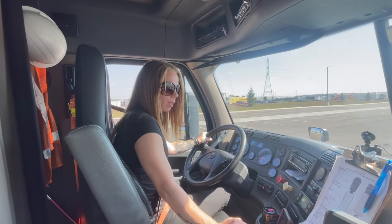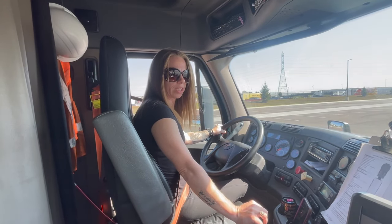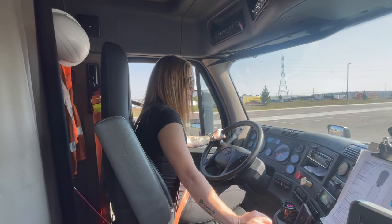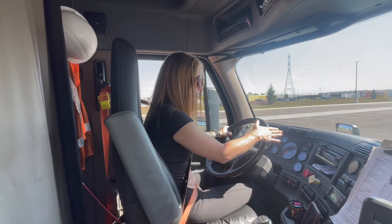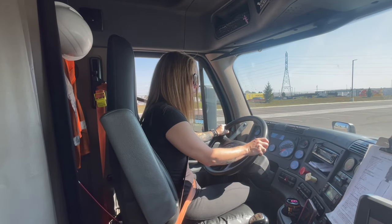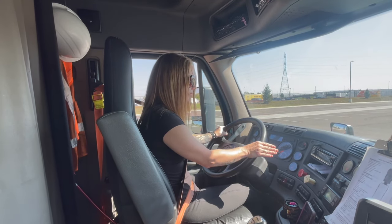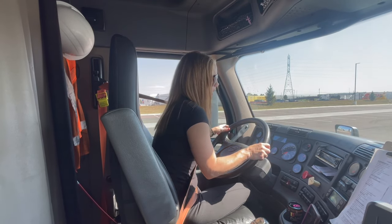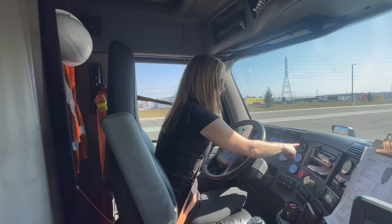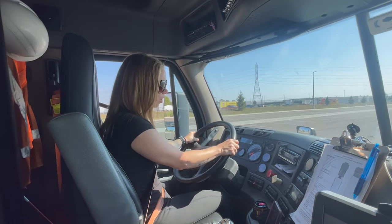Now I am going to set the parking brake. I am now ready to do my air brake check. My air gauge and governor cutoff check is first. I'm going to pump my brakes down to about 100 psi so that the air compressor can build air pressure back up. I am checking that the air gauges are working properly and the air pressure builds back up to governor cutoff between 120 to 140 psi. My air pressure built to governor cutoff at 140 psi.